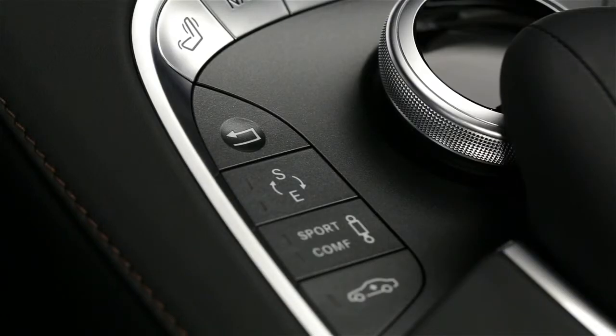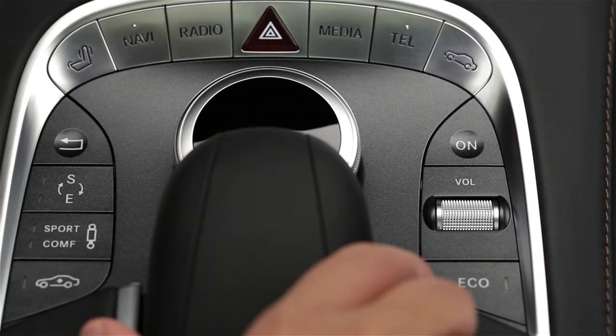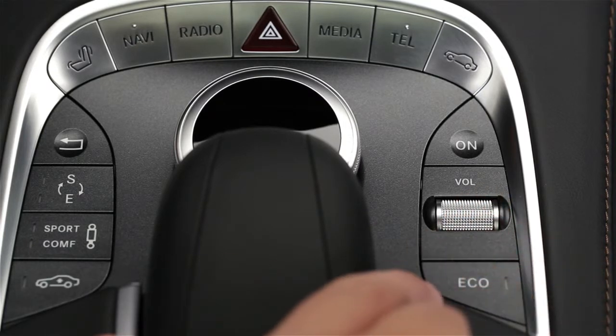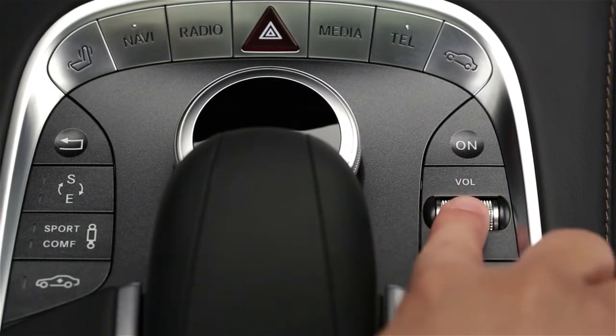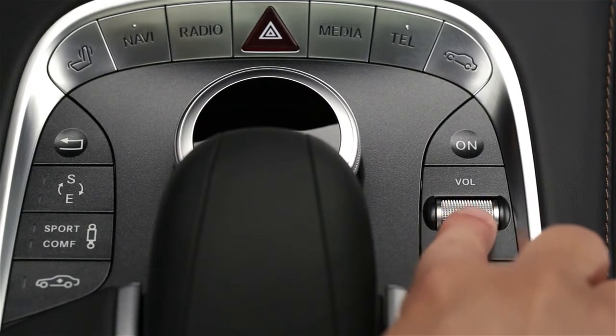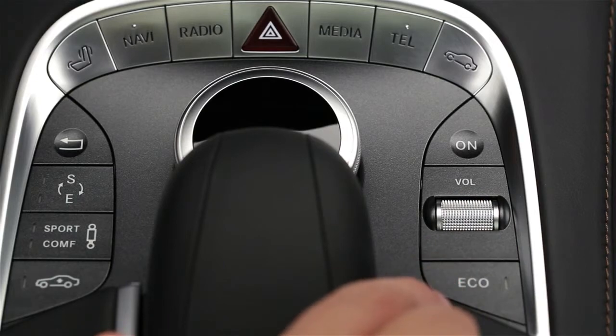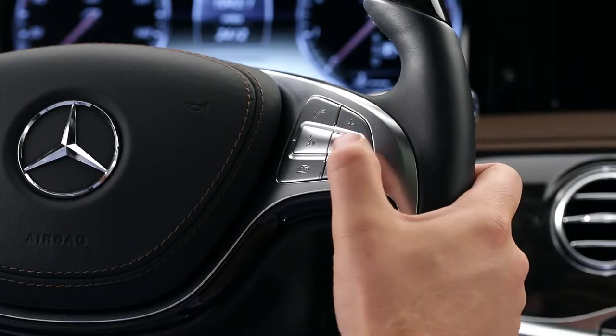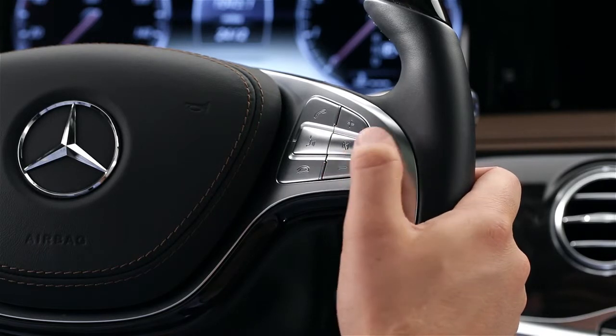There's also a back button with an arrow, a main power on button, plus a thumb wheel to adjust the volume. If you push the volume knob down, it mutes the audio, or unmutes it when you push it again. During navigation announcements, the knob will adjust or mute their volume, and during a hands-free phone call, it will adjust the speaker volume. You can also use the plus, minus, and mute buttons on the right spoke of the steering wheel for the same functions.